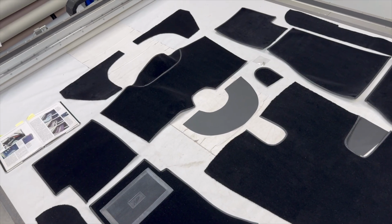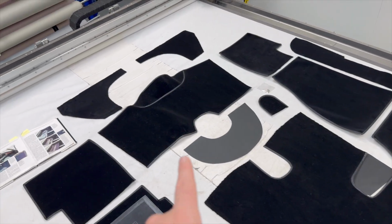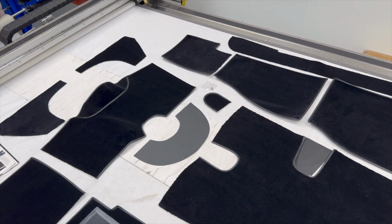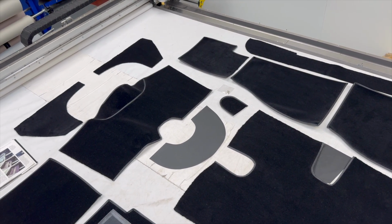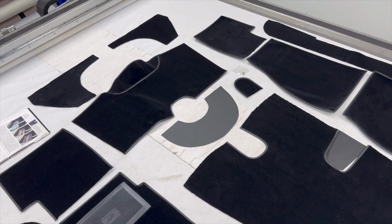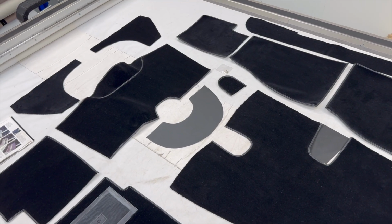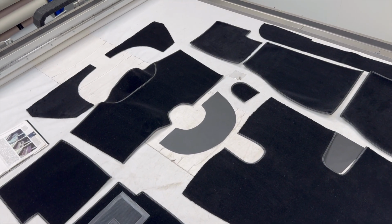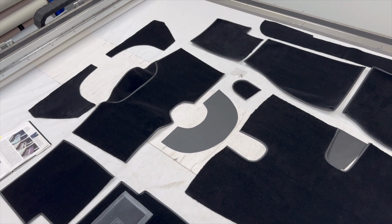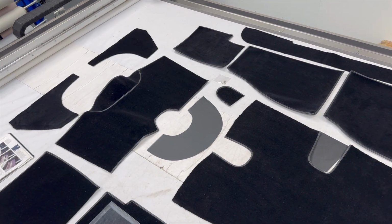And obviously for the BJ8s, you have the luxury of the fact that the console covers most of that as well, so you don't really see much of the join. But either way, the join is edged down that piece there. Now, the reason we've done the gearbox piece in two pieces is two reasons. One, it allows you to get easier access to the actual gearbox itself, but two, it allows you to fit the carpets a lot easier, i.e. the finish is better. Like I say, the one-piece gearbox tunnel carpets just look baggy and awful, whereas this two-piece one does make that process simpler.